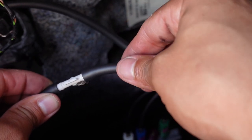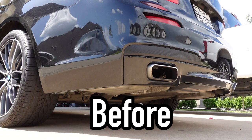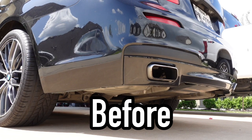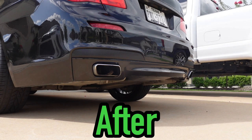Don't worry about a check engine light or anything like that. All we do now is start the car and listen to the exhaust. So that is it — the car sounds a little bit better, definitely sounds a little dirtier at lower RPMs. Before, the valves would only open above 3,000 RPMs, but now they're constantly open. I'm thinking about removing one of the resonators as well — the car has two resonators that give it a deeper sound — and I'll show you that in a different video.